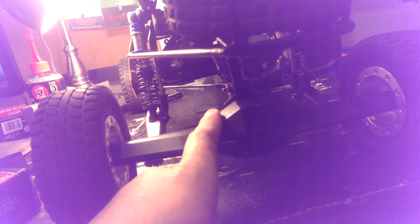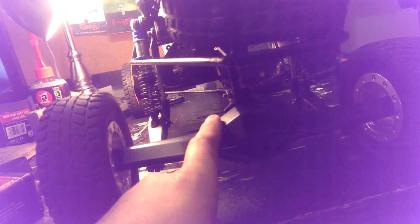RC four-wheel drive driveshaft, holding up great. I did have a problem with the pinion, the stock one that came in this axle. The pinion shaft broke in 3 places while I was driving it around, so I had to replace the whole assembly. I replaced the ring, the pinion, and the locker, because the locker wouldn't fit. I got the heavy duty bevel gear set for the HP, I think it was some Axial EXO, I can't remember.